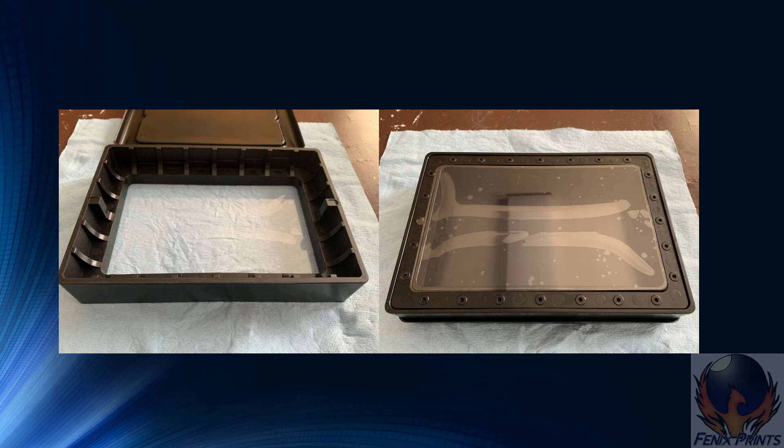This is what it will look like when you open up the top cover of the new plastic vat. You can see that they've changed the design a little bit. This has to do with how injection molding works, so this is a fairly standard design for what you would see in an injection molded piece. On the bottom side, it ships with a plastic cover on the FEP film to prevent any scratches in handling or shipping. You can see the plastic ring that goes around the FEP film and it has screws in it. My bet is that those are probably self-tapping screws, so maybe you could replace the FEP film, but those holes are likely going to be damaged by the screws to the point where you could no longer get accurate tension on the FEP film if you replaced it.